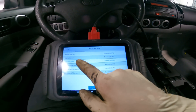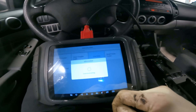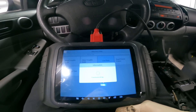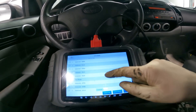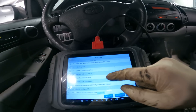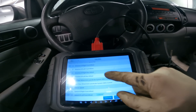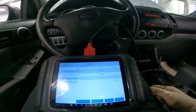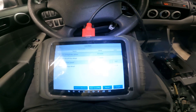We just cleared the code. We're going to go into the ABS ECU and look at live data for both rear sensors — right rear wheel and left rear wheel speed, and direction of the wheels as well. Start the car up. We did do the e-brake cables, so I had to take out the center console. Let's shut the light off and put this car in gear.